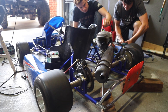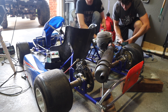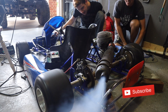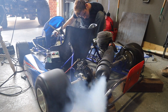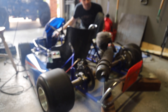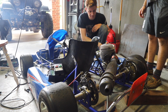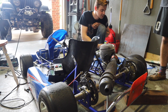Wow, that's like really fast. The drill cranks it way better — it's plenty of spark. Let's try again, this is way faster. She works! Yeah, sounds really good. Definitely need to do a little carb tuning — it does want to die — but yeah, solid. It's going to be kind of hard to start though. That's a lot of drill power — might need to ride it only in places where we have outlets.